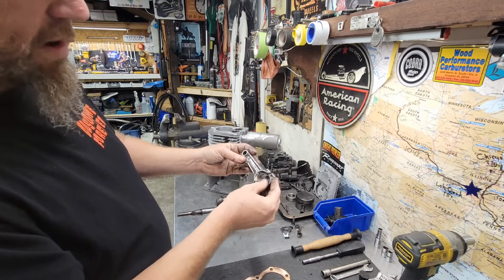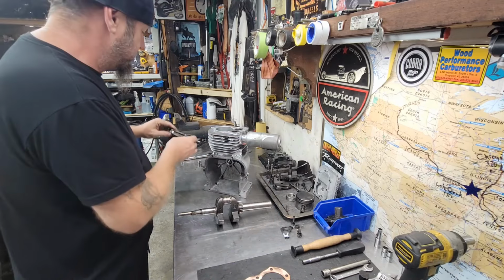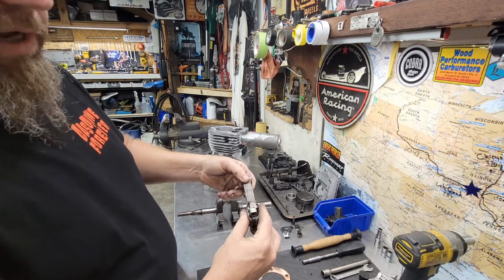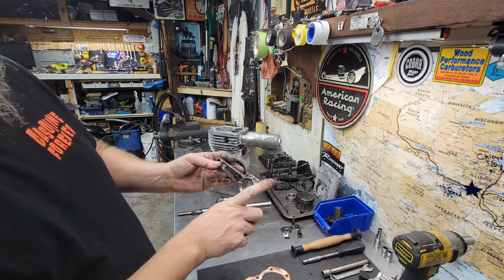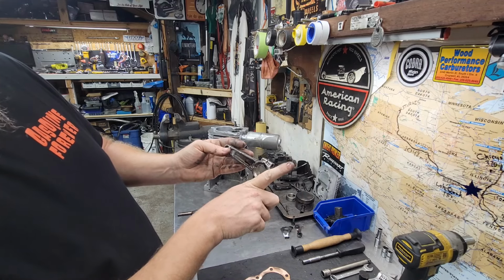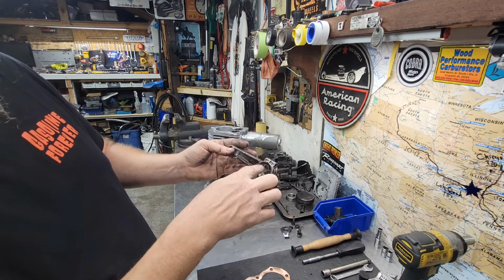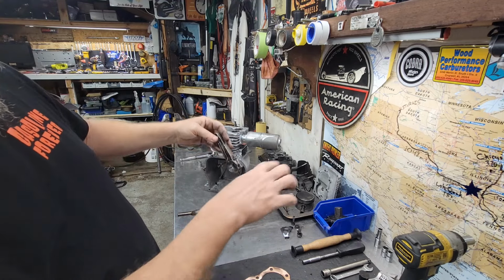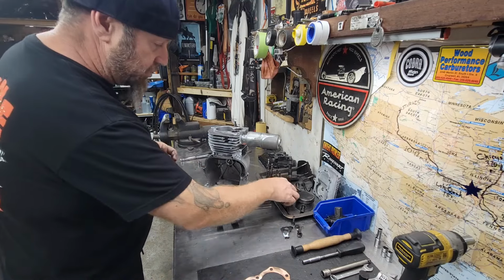The piston rod's worn out because the dipper was broke off, so that's getting replaced, and that's going to get an aluminum ARC rod, probably with the big, that's stronger with the dipper that has a hole in it, where it drips oil from the top and injects oil from the dipper. The dipper has a tube that goes in, and you get pressurized oil when it dips down. It pressurizes it and it works way better. So that's what's going to happen there.